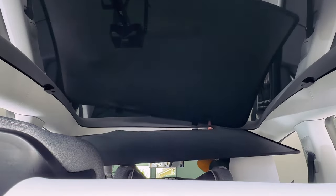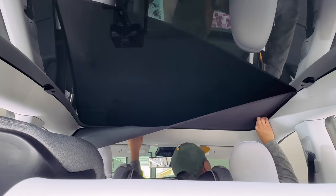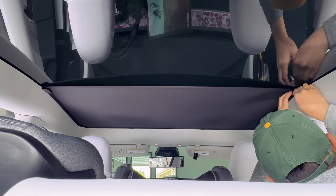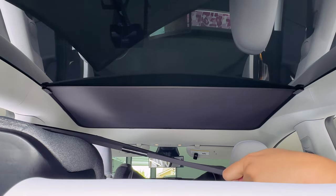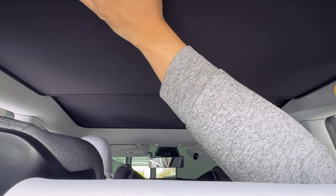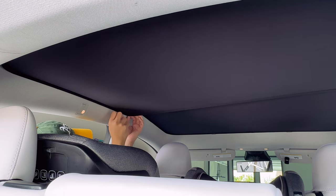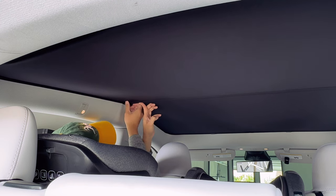Be patient as you lift up the piece and slide the two buckles between the glass and the roof lining. Go towards the back and put it between the big buckles that you installed first. Position it around halfway so when you install the second piece it fits in there also. The second piece follows the same steps — install two buckles first, slide it between the glass and the roof lining, and make sure the back part goes into the big buckles. That big buckle shares half with the front piece and half with the back. Once you get the two buckles in, push in the middle portion and they all line up.